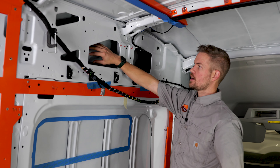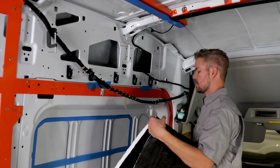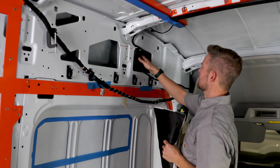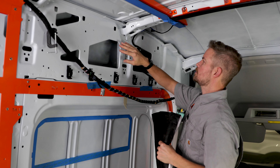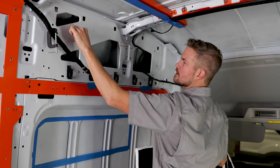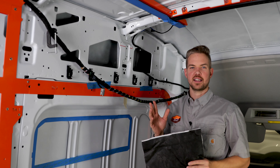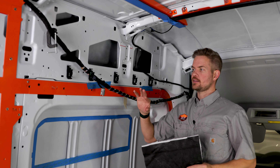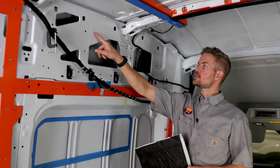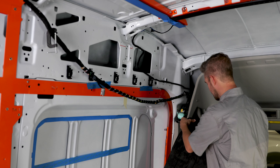Second, we're going to put our hush mat in this top section, then follow it up with the piece of insulation that goes into that cavity. There's a lot of room to work with back here, but once this part is in you won't be able to move it — there's a little beam back here. Once the hush mat and insulation are in, we'll rivnut this piece. This one actually takes rivets.